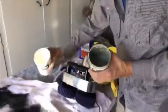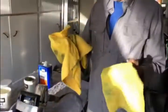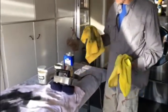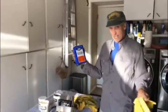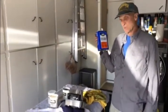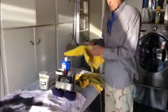The gray is the F7 and the white is the fine; the coarse is gray but a little darker. Be prepared to use a lot of these synthetic microfiber rags — you can see they get pretty dirty. After I do a buffing, I like to use denatured alcohol. You can get it at Home Depot for about six bucks, because it gets rid of all the residue after you finish polishing.